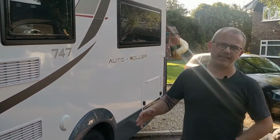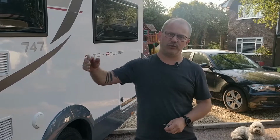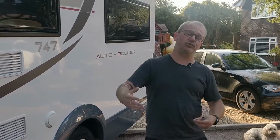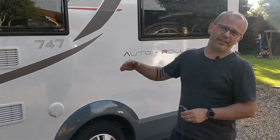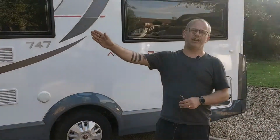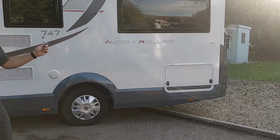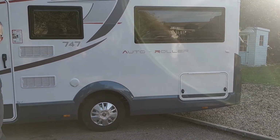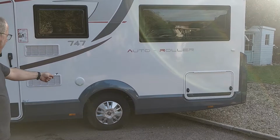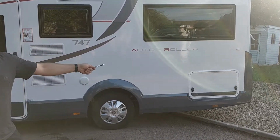And what everybody tends to do is they fill the van with diesel at the front, they jump in, they're preoccupied with the kids, the route, getting back to us on time, etc, etc, and when they leave the diesel station they tend to turn hard right or hard left. This is where the overhang on a motorhome can catch you out, because you fill up at the front, you put the lock on, and the back bumper can catch the guard protecting the diesel pump.